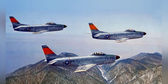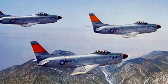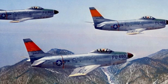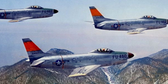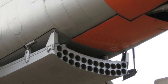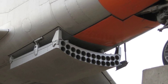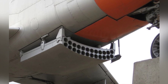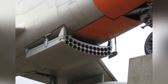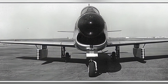In terms of power, the F-86D was equipped with a General Electric J-47 GE-17 turbojet engine in its testing and early production models. This engine, slightly larger with a length of 5.74 meters, featured an afterburner chamber that output approximately 33.3 kilonewtons when engaged. Additionally, the engine was equipped with an electronic fuel control system, allowing for fuel adjustments based on air intake and engine operation, reducing pilot workload and fuel consumption.